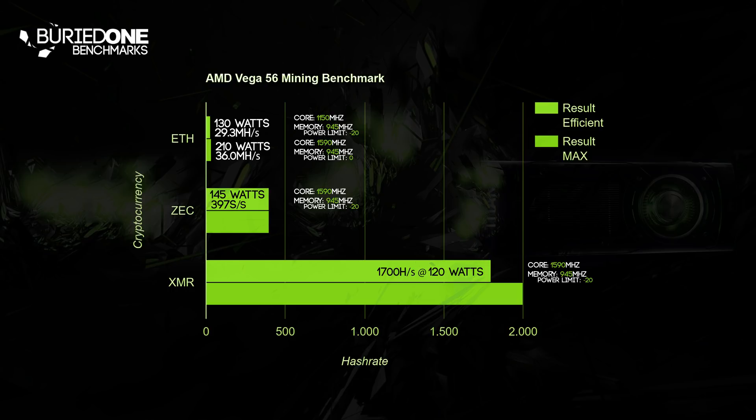The reason I said 36 and 38 is that when the HBM2 memory gets warm, the hashrate will degrade on every single coin. This card has a really large disadvantage in that it needs to keep its HBM2 memory cold. You will need to set your fan to 100% to maintain your highest hashrate at your specific wattage. As soon as it gets warm, you will lose about 10 to 20% of your hashrate — and that is really disappointing. Make sure you have some earmuffs on your head because these cards can get pretty loud.